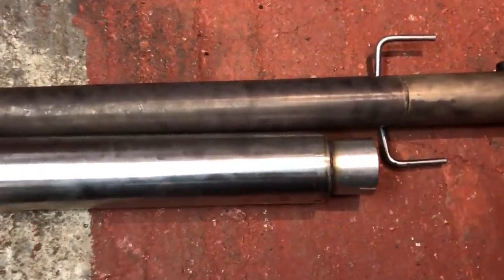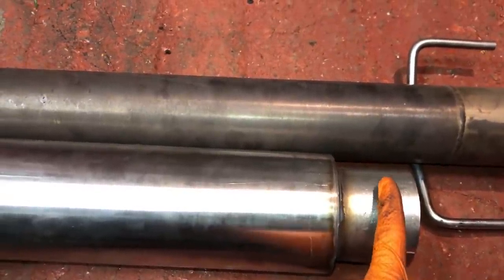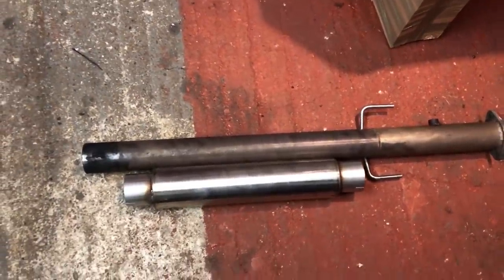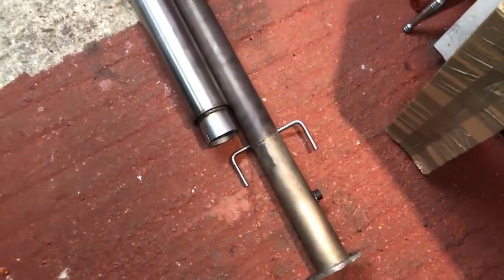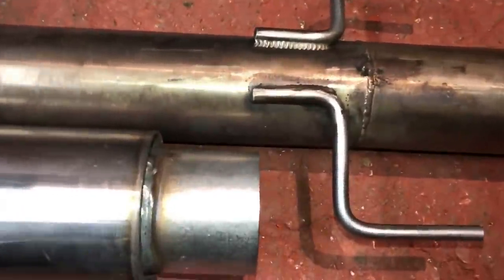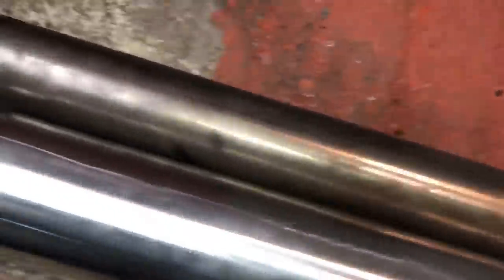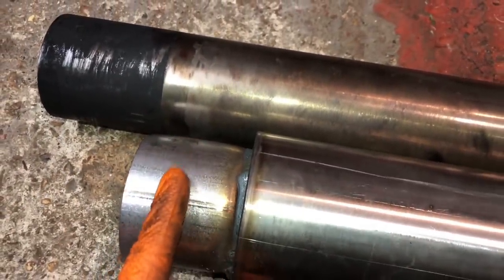That's the problem I'm going to sort. This is a clamp-on style resonator, which makes it easier to weld. I'm going to cut it in half and slot it over the top — you can see how it fits nicely in there. It's good that this exhaust splits up into three different sections, so I haven't even had to take the rear or front section off. I'll just mark it up where I'm going to cut. It's going to be a tight fit because of the brackets, so I'll cut them down about halfway and put a slot in them.